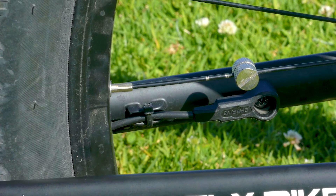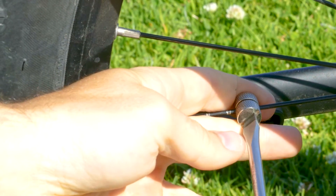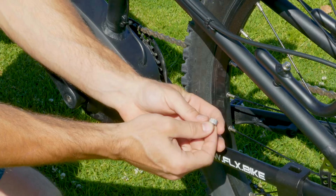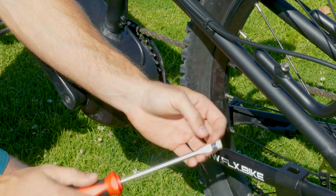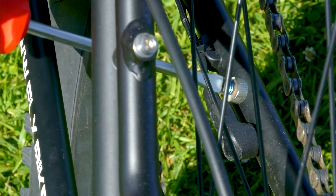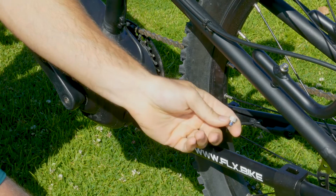All you need to do is remove your speed sensor magnet and we're going to activate it by hand. Loosen it and pull off the magnet. What I'm going to do is wave it in front of the speed sensor a few times and see if it can pick up some speed. Here's a pro tip — take your screwdriver, stick it right on the end of the magnet, and wave it right there in front of the sensor. With the bike turned on, I can look at the speedometer, wave it back and forth, and we're getting 25, 28, 29, 30. So that speed sensor is definitely working with the magnet in front of it.